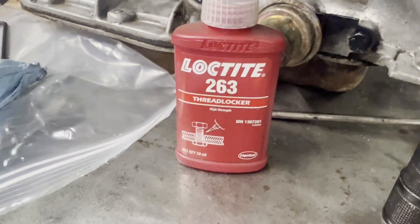We've got the red Loctite 263 on there, and that's it. Check out the videos when they talk about converter charge pressure coming out of that hole — I watched a lot of informational videos on YouTube and that's what made me decide to do this. I drilled out a piece of wood and put my set screw down in it so it wouldn't spin — don't put it in a vise and mess up the threads. Get a couple of drill bits because it is hard material. I heard another YouTube channel say to find brass set screws, but I couldn't find any locally, and ordering them they want $25 to $40 or $50 a pack. So a couple of $3 drill bits and you can power through that set screw.